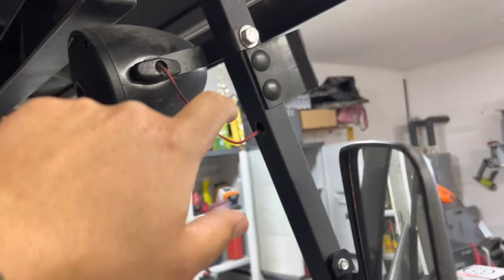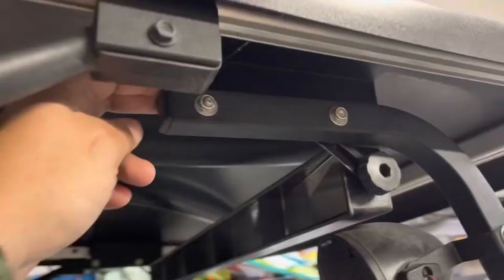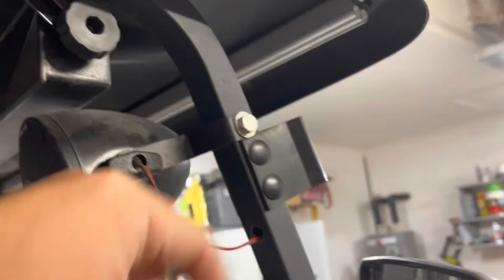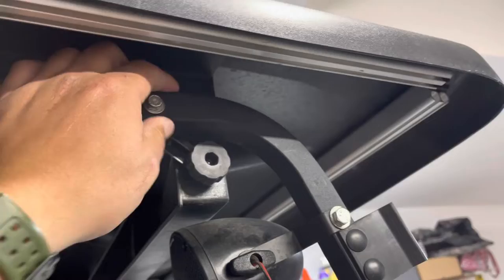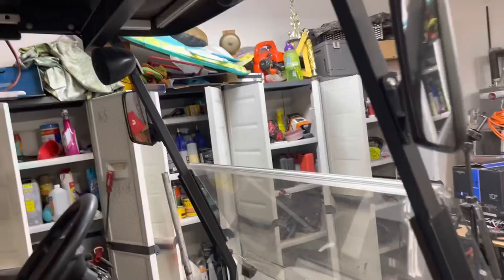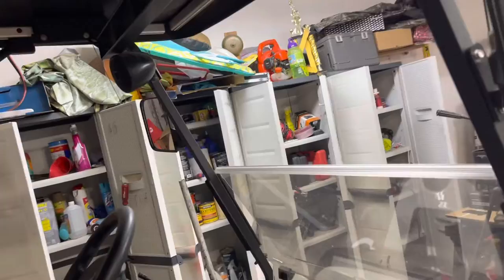The only thing this is going to get is a grouping of wires. We're actually going to delete these holes that were run in because they're already rusting — this came from the store they bought it from like this. We're going to come into this grommet right here, drill it out, and put a watertight grommet in there. We'll run the wires a little bit higher up so it hides better, and it'll have a waterproof grommet. We'll fish tape the wires — four runs on the left side for the speakers and super tweeters, and on the other side probably eight wires for toggle switches, giving them the option for more down the road.